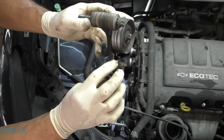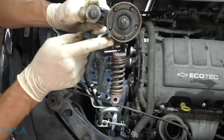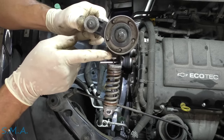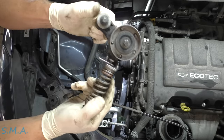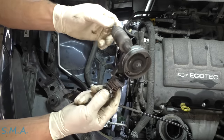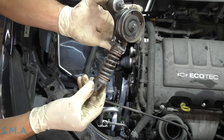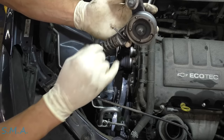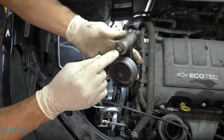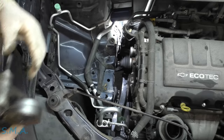If you don't pin it, the whole thing stretches out until it hits the top of the T, which holds it all together. It's kind of a chintzy design — compress it, put a pin in to hold it. That allows you to put it together easier because if you let this thing go, it grows another half inch and it's a real bear to get the bolts back in. Not impossible, but it ain't easy.